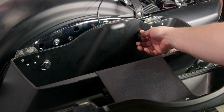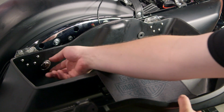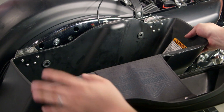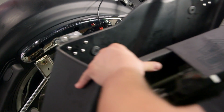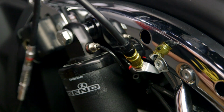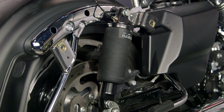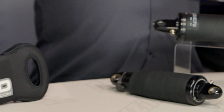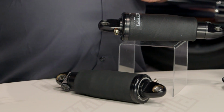So you are going to have to actually pop off a bag in order to get to your suspension, to the factory Schrader valve, and you're going to have to do this thing by hand. It's going to take a little bit. It's not impossible, but again, you can wear your arms out. If you're trying to go up and down very frequently in a small space of time, the HVG kit might not be the best way to go. But if you are looking for air adjustability and you want to get in there without breaking the bank, this is the way you want to go for things.